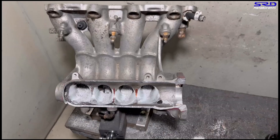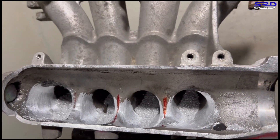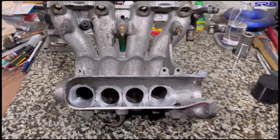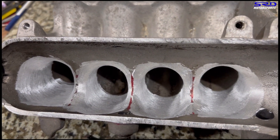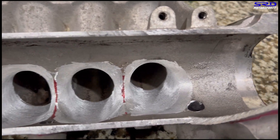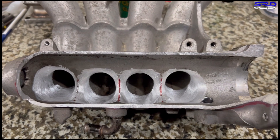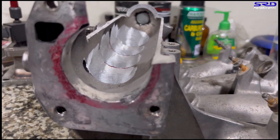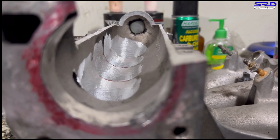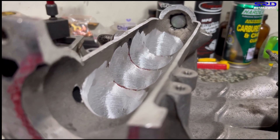The shape is starting to get to where we want it - it's flared pretty good. The roof part still needs to be done. After spraying it with water it's cleaned up without debris, and you can see the flaring is starting to look like a velocity stack on each of the runners, especially the one near the throttle. Looking at the side, by flaring it like this you start to slightly increase plenum volume, which is definitely a good help because the runner sequence of the PO8 manifold is already really good.